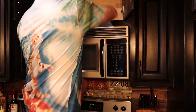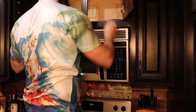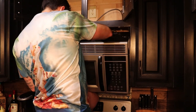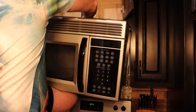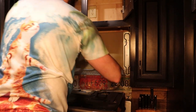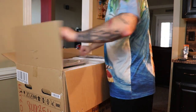Once you get the two bolts out and you have the one bolt just barely remaining, go ahead and take the last bolt out. I used the power of my kitty cat surfing on a pizza shirt to help me do this. Maybe you can get a friend to help. Microwaves are kind of heavy — not insanely heavy, but you can cut your hand removing one by yourself. They're held on by a bracket, so you've got to drop the front and then pick up on the back to remove it.